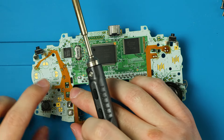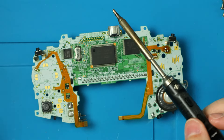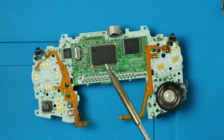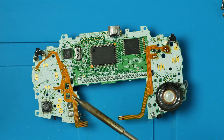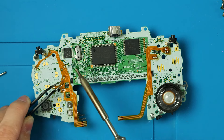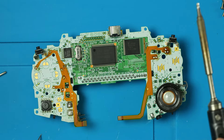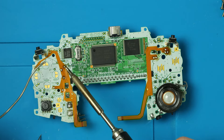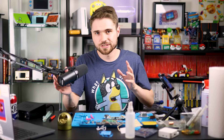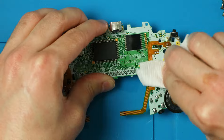I can see TP7, TP2, and TP3 — so TP3, TP7, and TP2 get solder down too. Once all points are lined up with solder shining through the holes, hold the ribbon cable down and solder the farthest point, then TP2. If it doesn't solder well, add more flux — you can never use too much no-clean flux. Add solder to the tip, make sure it's lined up, touch it down. Do the same for TP7, then flux all remaining points and solder them all down. Then I'll put down the iron and clean up the flux with isopropyl alcohol and wipe down the gold pads for the buttons.